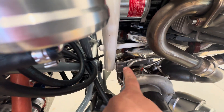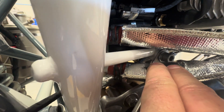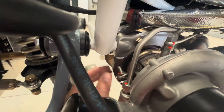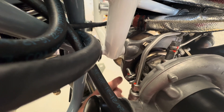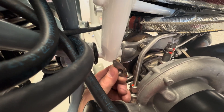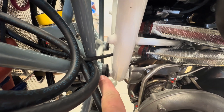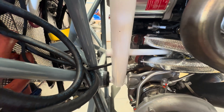What you have to do is undo about four bolts that hold this bracket — it goes from the engine mount and holds part of the turbo. There are actually a couple of them, four total. That lets you pull this out of the way so that you can get in and drill out the rivet to pull it free. Then you can put the engine mount bolt, the M10, through and put the Sling lock nut on with all the other little pieces.